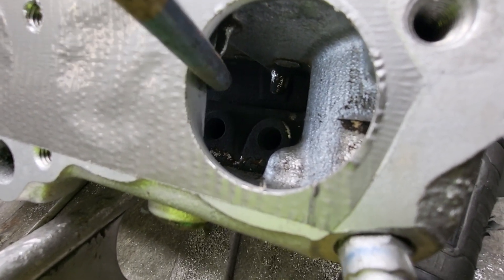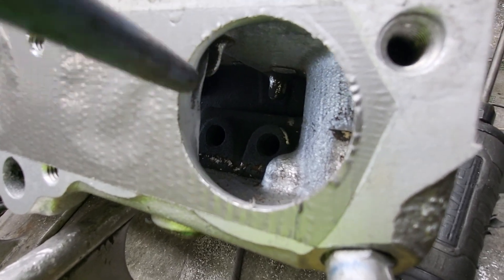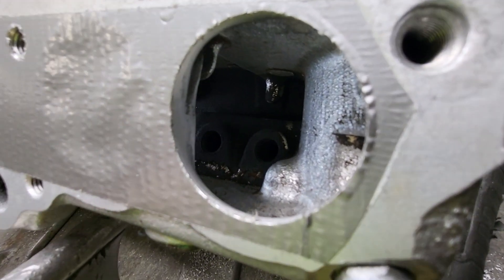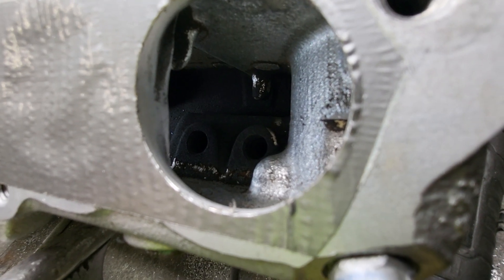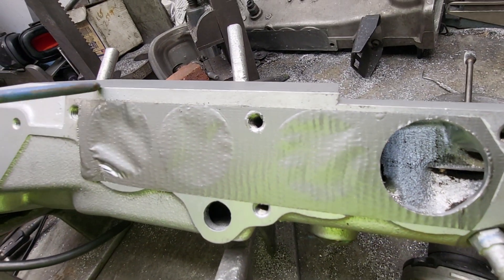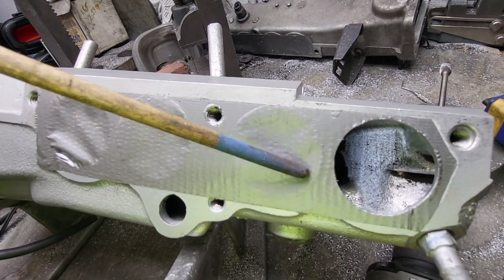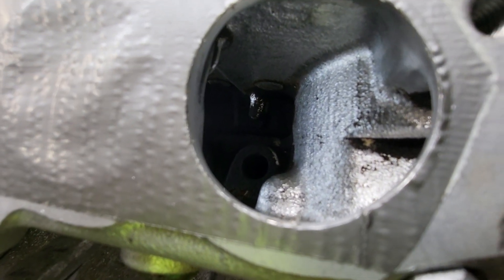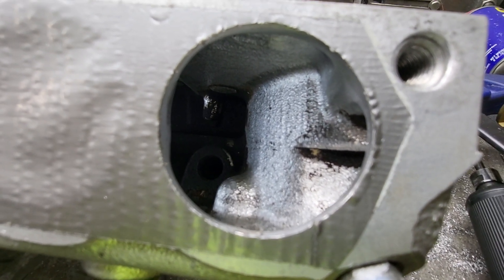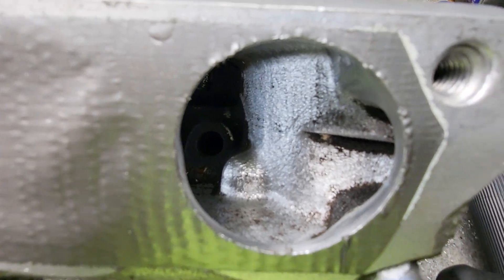Unfortunately the way it worked out, it's actually quite close to this fin they put between the two runners. My plenum doesn't have this fin, so it makes it very difficult to put a radius on this side into the plenum. I don't want to take it out though — I think it's probably there for a reason. It probably has to do with buffeting of the runners, because as you have air coming down to this runner it goes across these other runners and can cause a buffeting effect — kind of like ram tubes on carburetors, right? That's why they can actually make more power. There's a great video on that recently from Unity Motorsport — you should definitely check that out, he's doing a lot of cool stuff lately.